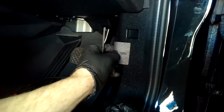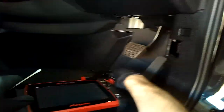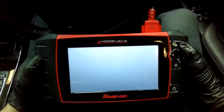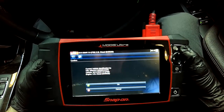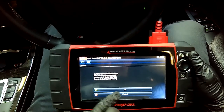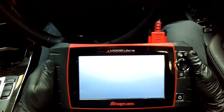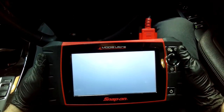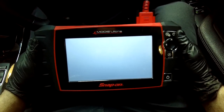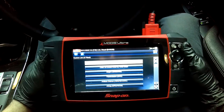The next step is to get the vehicle ready to have the new brake pads installed. I get my scan tool, hook it up, and get it ready for the pre-installation section of the brake pads. There's an electric motor on the back of the vehicle which controls the electric park brake — that needs to be deactivated and wound back before you can install the new brake pads. The pre-installation section on my scan tool allows that motor to wind back, and after that mode is complete I can go in and remove the brake pads.